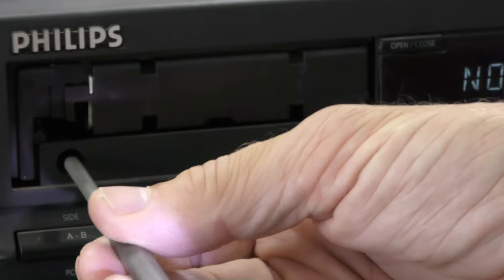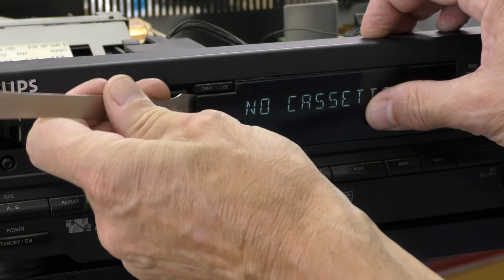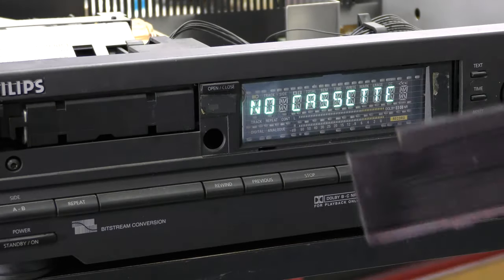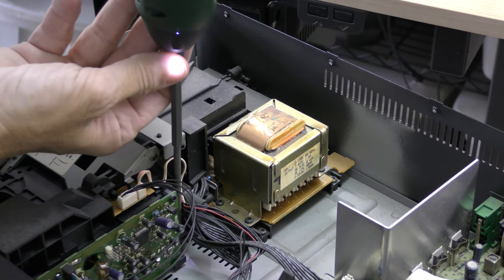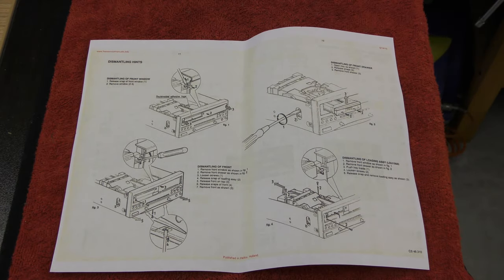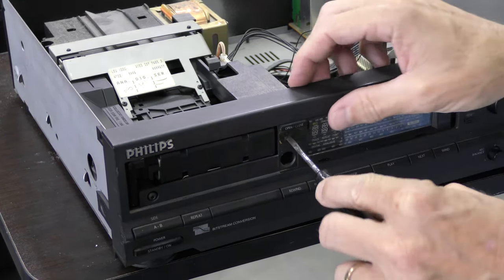Now you have access to a screw that has to be removed. With a small flat tool, remove the display from the side, top to bottom. The remaining two screws left and right can be removed. In the service manual it is specifically mentioned how to remove the mechanism by releasing a hidden lever from the front, which is why you have to remove the display cover to prevent breaking that lever.